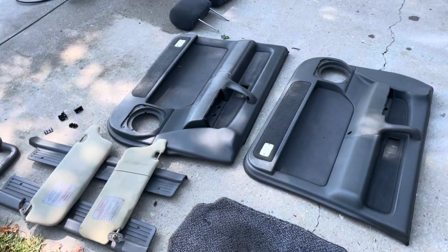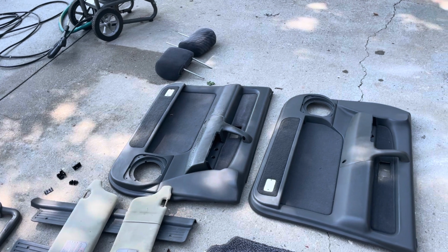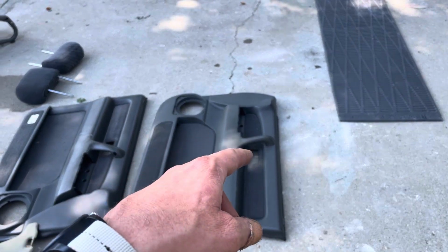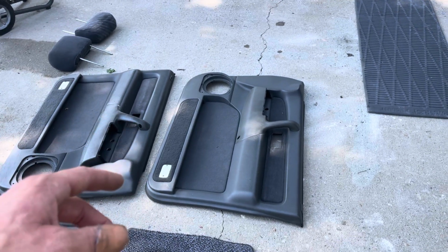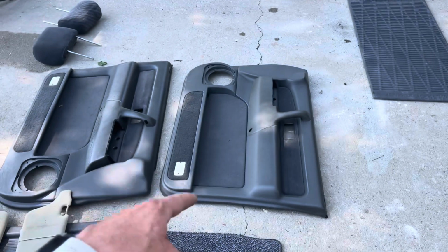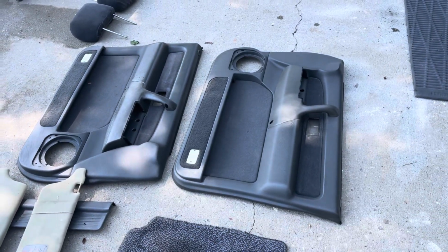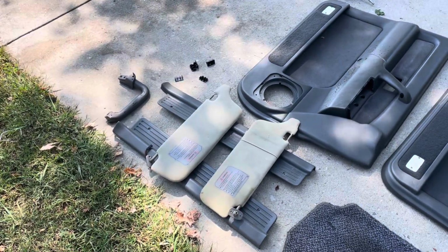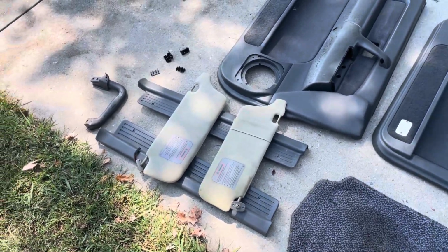So the door panels come off. Honestly, if you've taken a door panel off before, most door panels are very similar. You got a couple screws by the handle, another one by the grab handle, maybe one right there, and then there's clips around the outside, and then it lifts off. You can have these door panels off in 5 minutes. The Japanese stuff, they don't typically hide the fasteners like the Germans do, so it's really easy to get to the fasteners. This was all 10 millimeter, 8 millimeter, and Phillips.